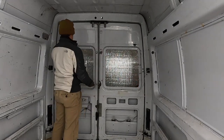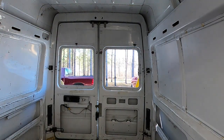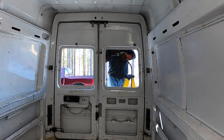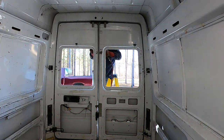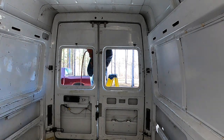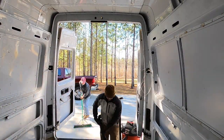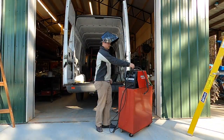Eventually we resorted to using an air chisel to just air chisel the urethane off of the van, and that turned out to be the most effective way — it just zipped right through it. We did have a couple of places where the air chisel dug into the metal, but fortunately the new windows don't use the same size opening, so we're going to trim out a slight bit of the opening and hopefully trim out the damaged areas. Once we got all the urethane out we cleaned up all the glass that had flown everywhere.